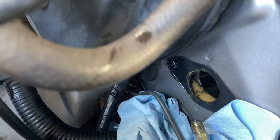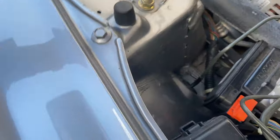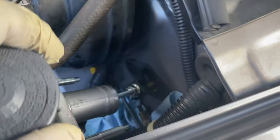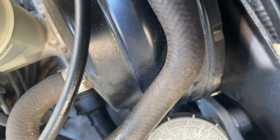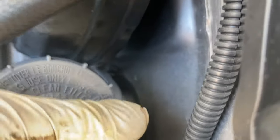Clean it off before you put it in. When you put the new master in, you want to put it in this orientation so the bolt can go through. You don't want to be playing around with it — it can turn easily, but just put it the way it goes, sort of like this, and push it in. Line them up with the holes. Make sure it seats good. Watch out for the old line — it might get stuck. Just rock it back and forth until it sits.